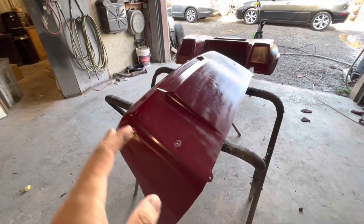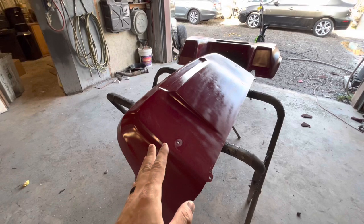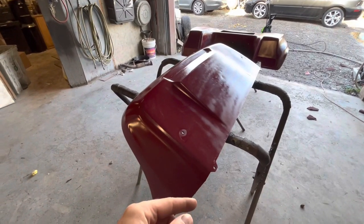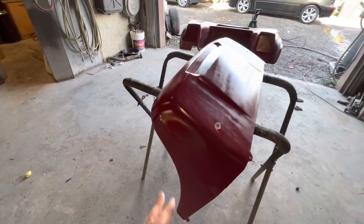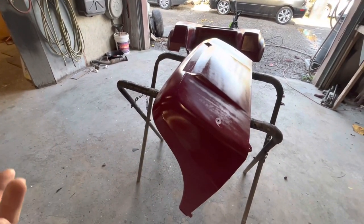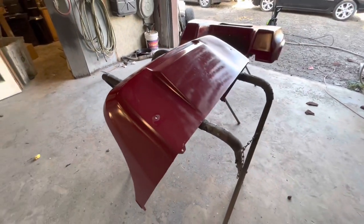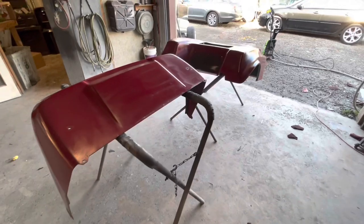So the only way you can sometimes get this stuff to lock down without removing it is if you do a bunch of dust coats of base coat on it and you add a hardener to your base coat. So we're gonna try a couple methods, but we need to prep it anyway, so we're gonna try to get all of it off that we can, so we have as little to worry about as we can, because I don't feel like stripping it, because like y'all say, it's just a golf cart. Let's get started.